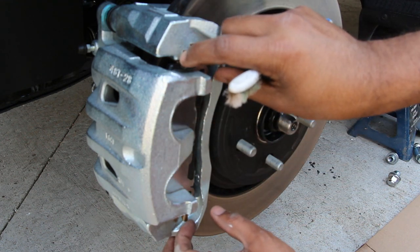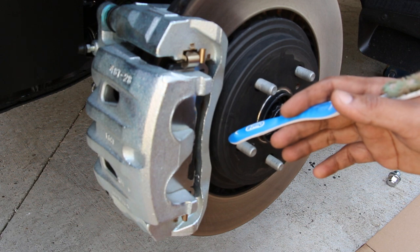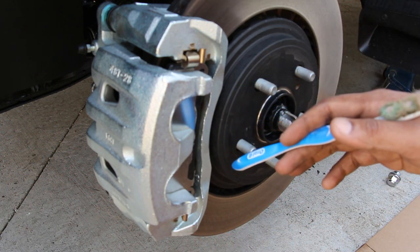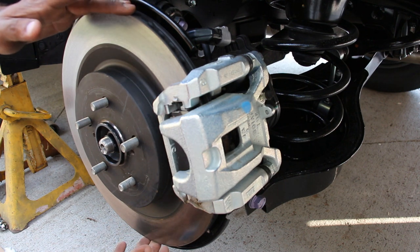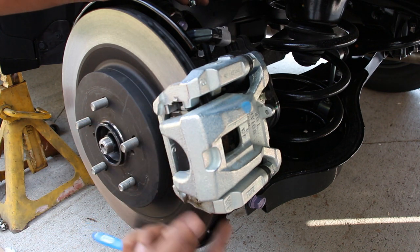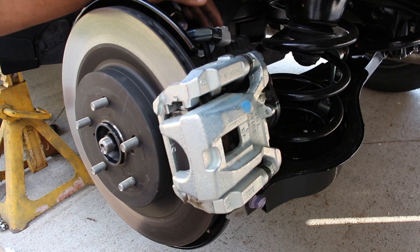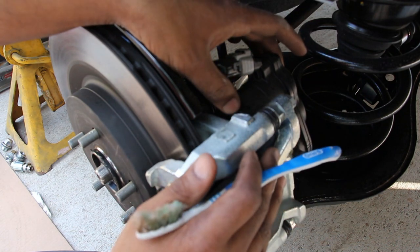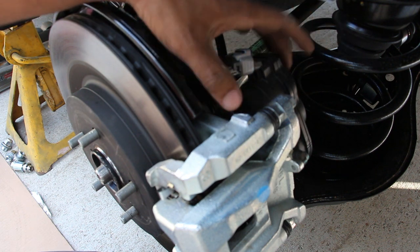Taking a look at the front brake setup on the Highlander, we've got a dual piston design that drives a good sized brake pad on this disc rotor. While on paper this might be sufficient for the Highlander's size, driving this particular vehicle with only 60 kilometers on the odometer I felt that these brakes were not really sufficient for the size of the vehicle — it's almost as if I was towing another 5,000 pounds behind me. Taking a look at the rear brake setup, you have a nice sized rear disc rotor with your floating caliper design, but they kind of cheesed out on the size of the pad — it's actually pretty small, something you'd find on a Camry. When you load up this vehicle with payload or tow a trailer, I don't think these brakes are going to be very sufficient. Tagging along behind that rear brake rotor is the electric parking brake actuator. Luckily if you have to do a rear brake job, there is a manual way — you can put in a Torx bolt here and unwind it, so you don't need a special scan tool to disable it.